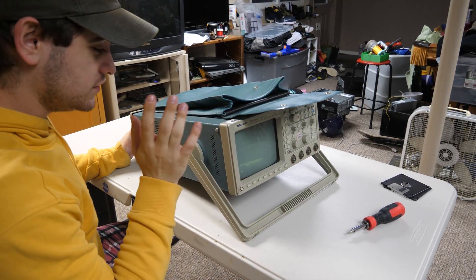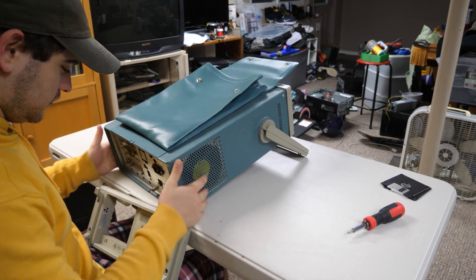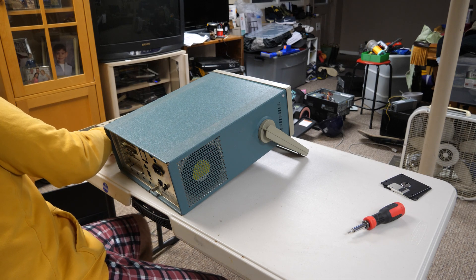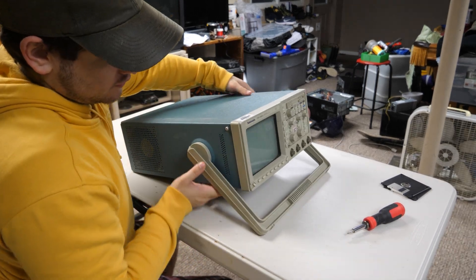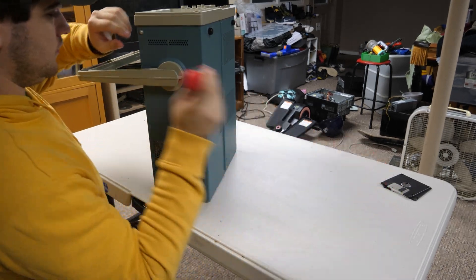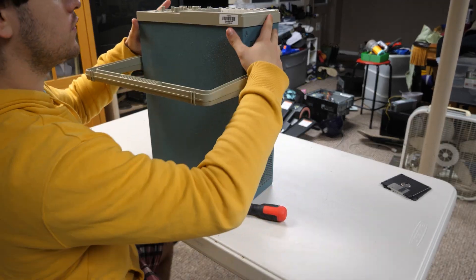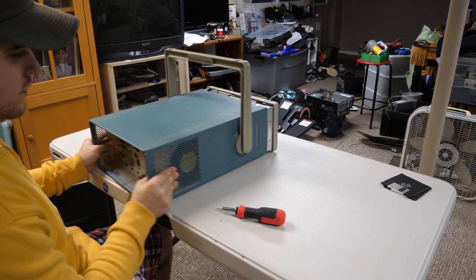So, we're now at a different angle. We're going to take this thing apart. First, we'll slide off the back plate, because we took out all the screws. Then that allows us to slide out this leather pouch, which I have to say is very nice and I love the color. Most of these that you find don't have the leather pouch still on them because they're either cut, torn, or just gone. So now, this carrying bar — we're going to flip it up so that we can take out this screw. Thankfully, all the screws on the outside use the same screwdriver, which is a T15 bit. And we push it out forwards.